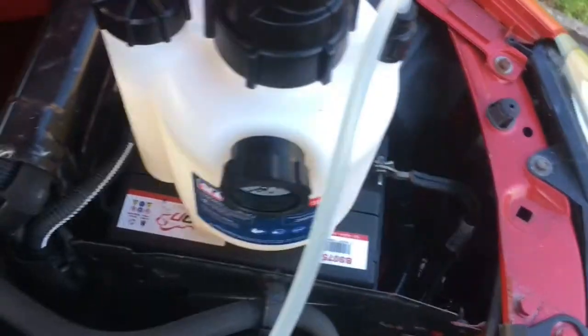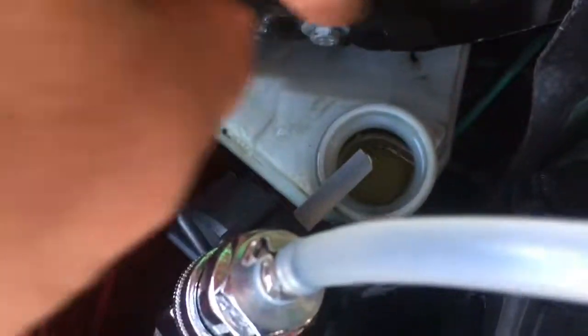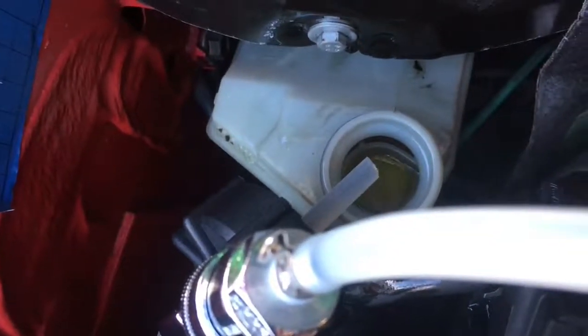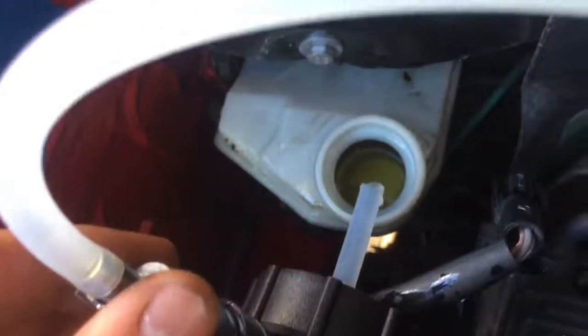So a nice feature that this pump has, you can still pump it and build pressure even if the attachment isn't on the reservoir, so you can fill the reservoir without pushing any air into the system. Builds pressure nice and quick, just a couple of pumps and it's off flowing again. Release the pressure and it'll drain what's in the tube and stop pumping.